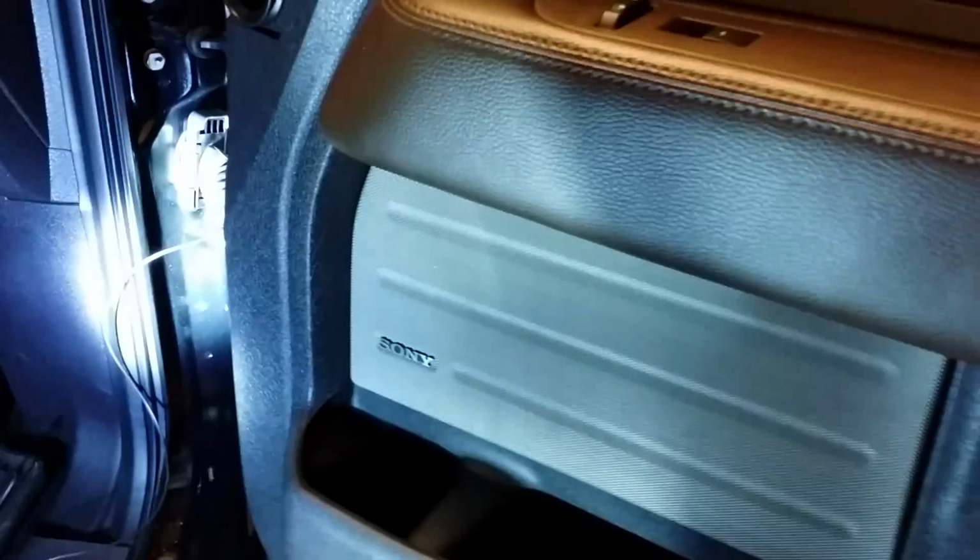And then you're going to take a small screwdriver with a bit and drill a small hole through the inside of the grommet with which you can run your power cable out of. Once you pull your new power cable through the hole you just drilled, just reinsert this grommet into the door and reinstall your door panel, like so.